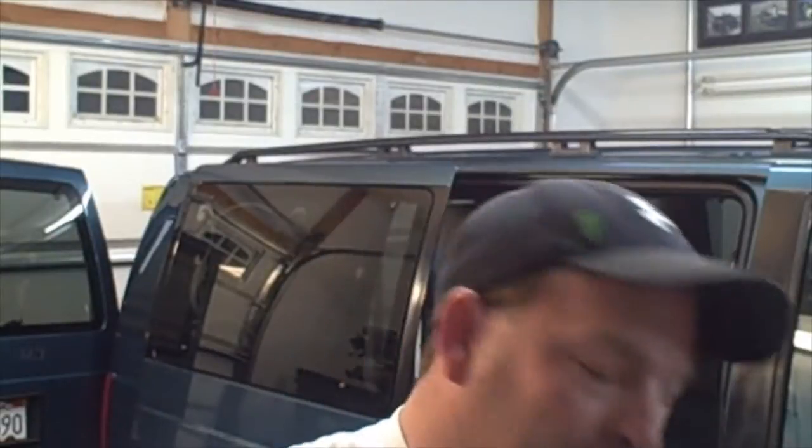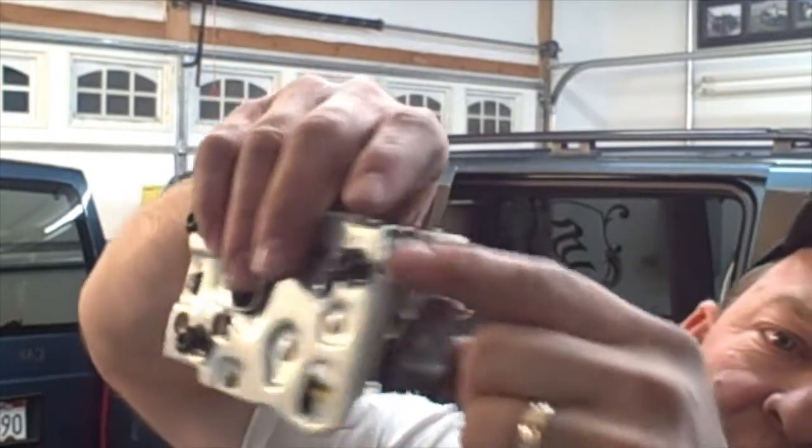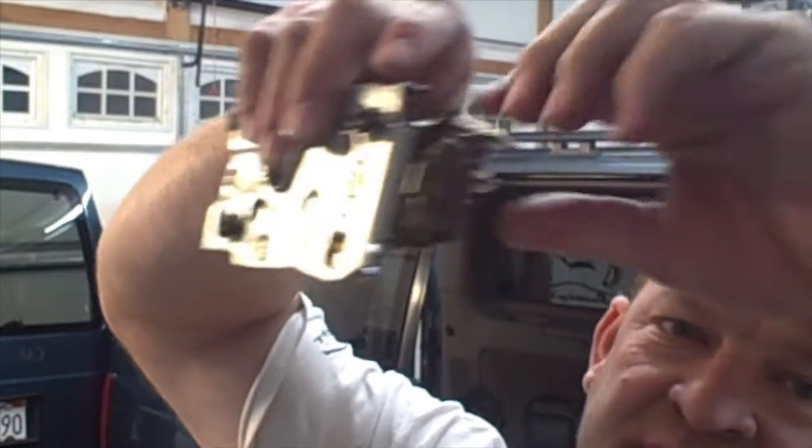We just finished up the van. Actually before we put it all back together, we took the latch out. Sometimes these latches will get bound up, get grease and grime in there and then they stop working. What actually caused this motor to go bad was this lever right here — it was just gunked up and full of goo, so we had to pull the door jam apart to get that out. I definitely recommend cleaning that door latch; that will really help the new motor so they won't have problems. Hopefully you guys liked the video — please thumbs up if you did, let me know. I enjoy your comments and I read every one of them. We'll see you guys in the next video.